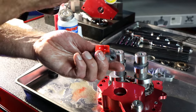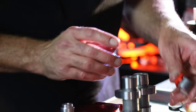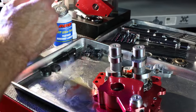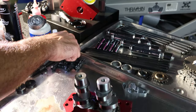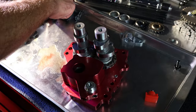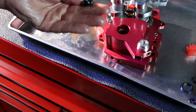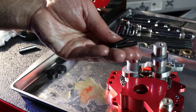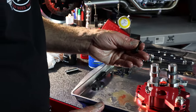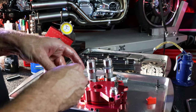Put plenty of assembly lube onto the pad. We include new hardware for the tensioner housings — some Allen head button heads. We are going to use Loctite on these, with a little ARP lube on the under-head flange so that we get a good clean torque, and then we're going to use Loctite on the threads.